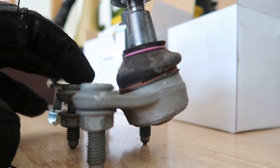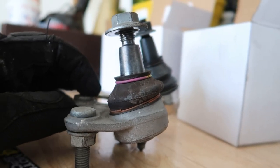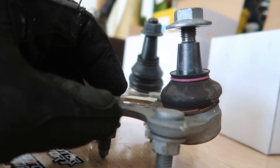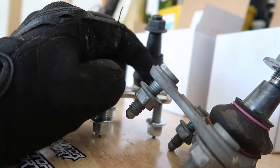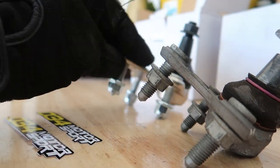You can see here how much more camber that back one would give due to the angles. It's much longer too, so this one is going to sit lower — which brings your control arm down, and that's going to help correct your roll center.